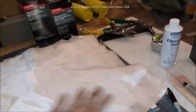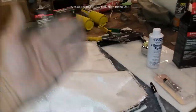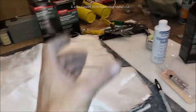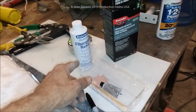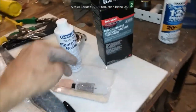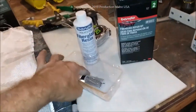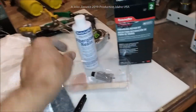It's so simple — you just take what's left of something, wrap it in aluminum foil to make your form, cast this around it using a one-inch brush and the little tub it comes with, which includes hardener and resin. Get a bigger container, but look below the video — I'll put the link to that.